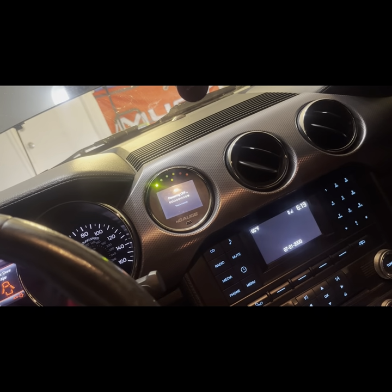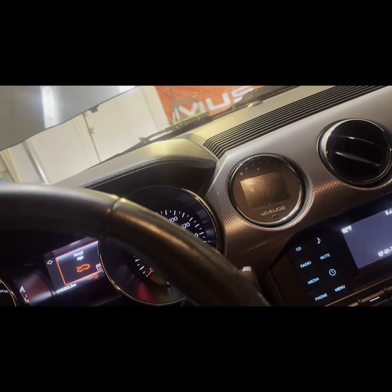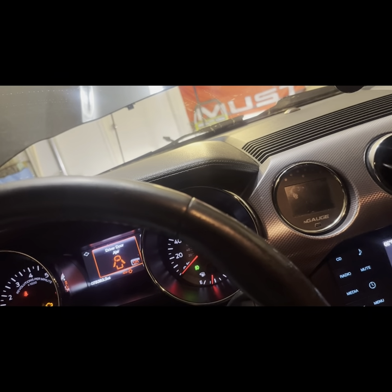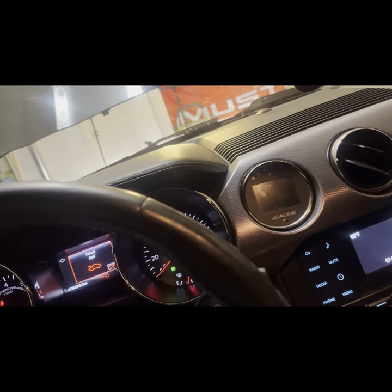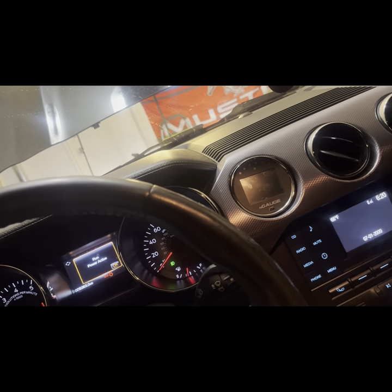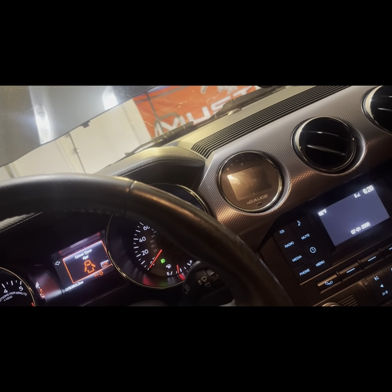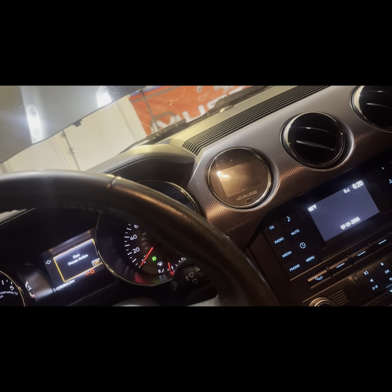For all you Camaro guys, your Chevy guys, you can run an RTD by HPP, and then go to your local shop that y'all are familiar with that does a lot of work on Chevys, and get a tune, a revision, dyno tune, however you like. I prefer street tunes over dyno tunes, but that's me. And like I said, this is your number two. That way you unlock the full potential of the vehicle by getting your 93 tune, E85 flex tune, or E85 tune of your choice. So, that's that.